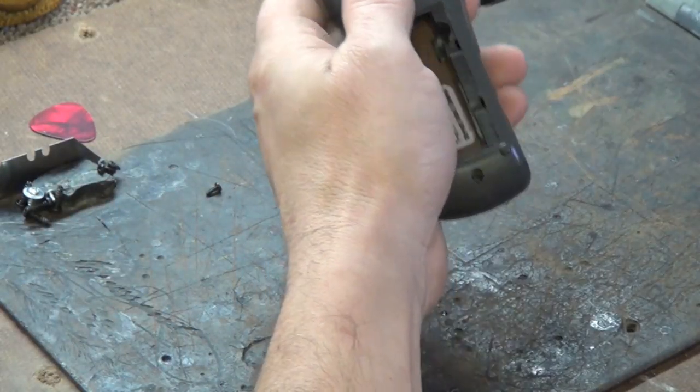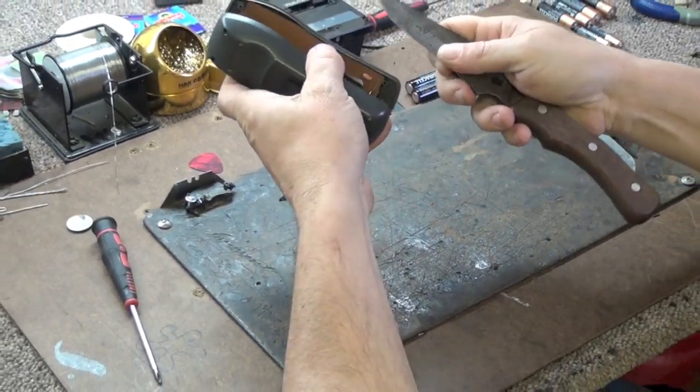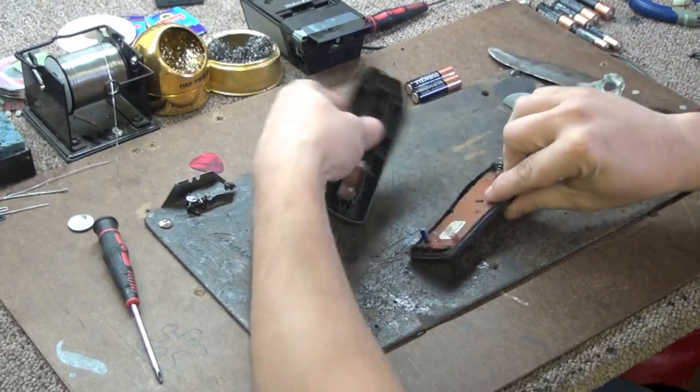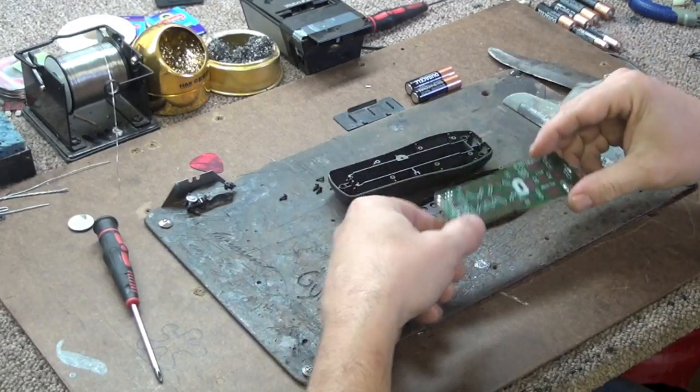After that you will get a dull knife. Put it in the sides of the remote control where the small slit is, turn your hand gently, and the knife will make the remote control pop open. Then you will need to remove the circuit board from the keypad.